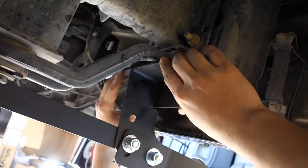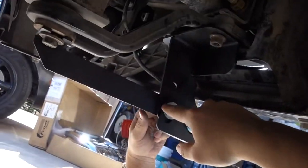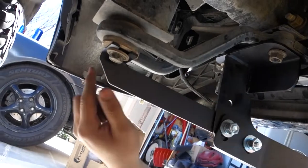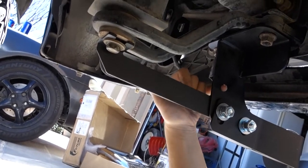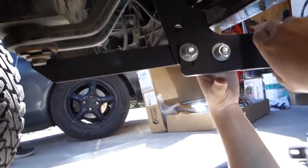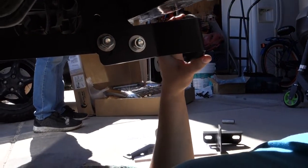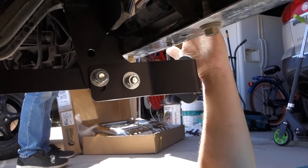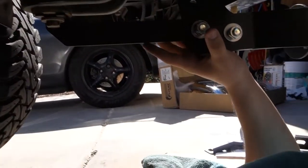So this metal plate, which is just one of them, snaps on right here. It's going to unbolt these and snap on, coming up to this shape. Then you need an extra arm back here — it goes from right here. This first bolt back here is the arm, and it connects right here from the tow hook if you're keeping the tow hook. If you're not keeping the tow hook, then you put it up in this hole — that's why they leave you this hole. It makes you decide if you want to keep the tow hook or not. Once you get this set up, you get this one with the circle. It's still loose because you don't tighten anything until you're sure. This is going to hold the ram bar. I'm hoping there's enough clearance so it won't hit the tow hook. It took us a while to figure out this format, but we got it done.